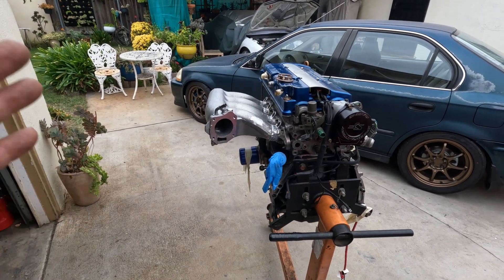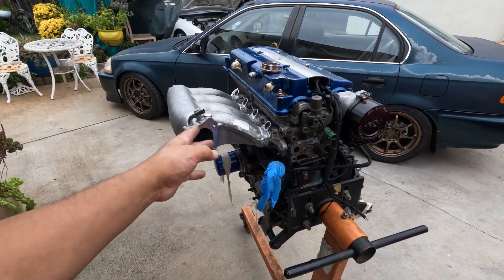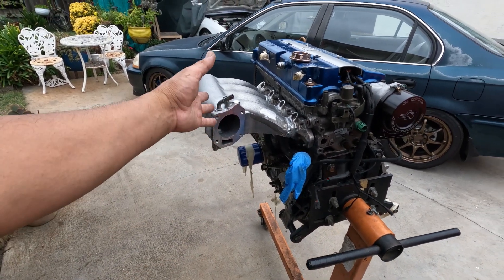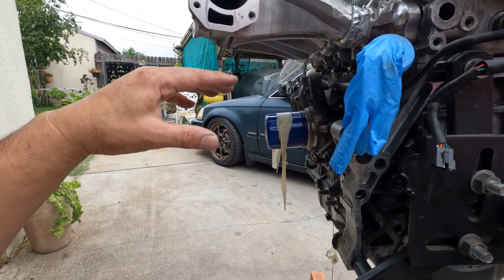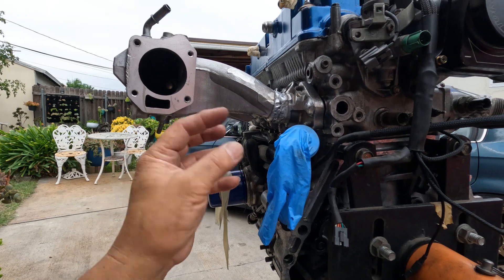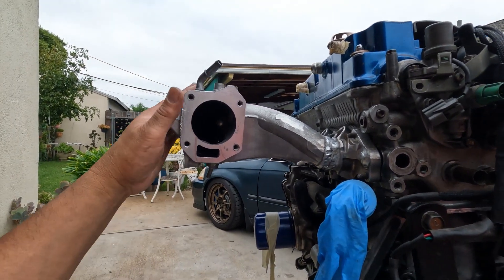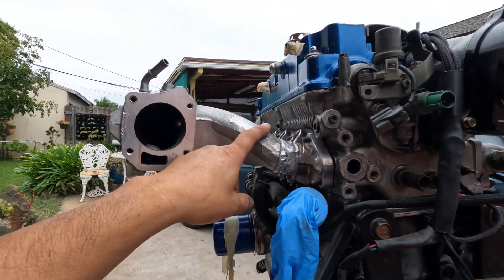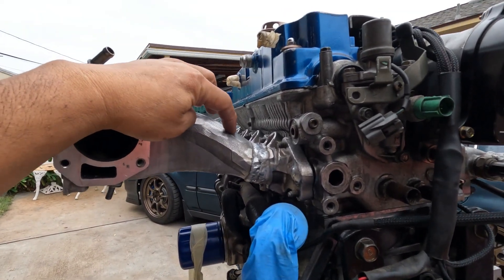Let me explain why I do what I do. What I envisioned was an RBC intake manifold without the adapter and also without modifying the rear T bracket — which is exactly what I did here. I've got plenty of clearance for the T bracket, about an inch and a half. As for the thermostat housing thermal switch, I'm simply going to relocate it pointing up. I couldn't tilt it up any more because of the fuel nozzle — the more I tilt it up, the more I lose clearance for the fuel rail.